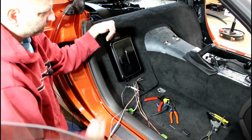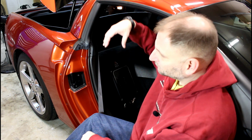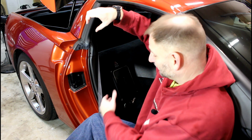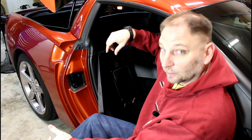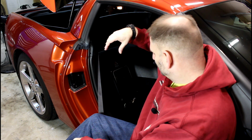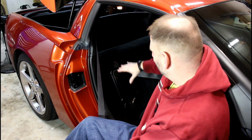Now we'll get to this. The speaker wire's angled this way, so as you're trying to come up, you're having to come back and up. This is after we're installed, and I'm just throwing this in there. I didn't convey this very well in my video, so that's why you're seeing this now. The actual terminals on the amplifier aren't straight down. They're actually angled in like that. Why does that matter? Well, for me, because of that trunk wall, it was very hard to come up and come in like that with the speaker wire. The power ground, not so much because they're large, and I got those terminals on those posts, so that was easy. The turn on was easy. It was really the speaker wire. It was really a pain in the rear end, and that's really my only complaint about this amplifier.